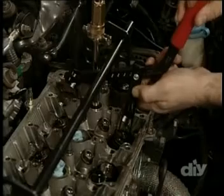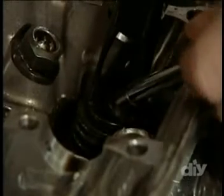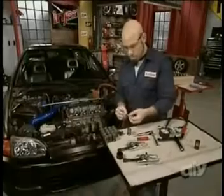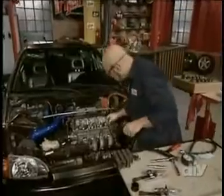Use the pivot arm to release pressure on the valve spring locks. Then, remove the locks from the top of the first spring with a magnet and pull out the old spring. Next, combine the locks into the retainer and add the retainer and the locks together with the new spring onto the valve stem.